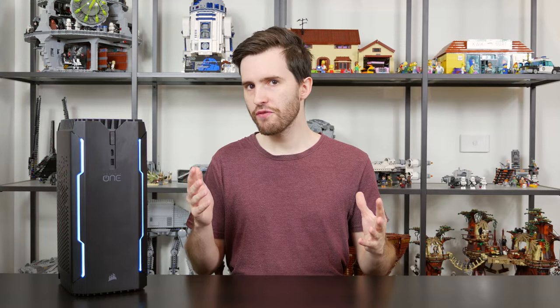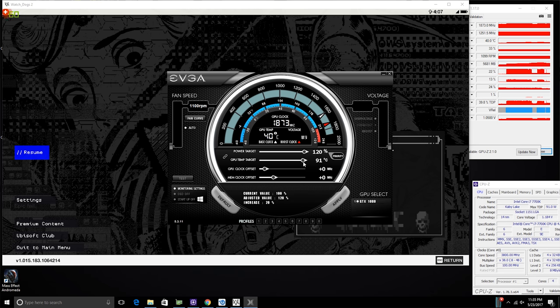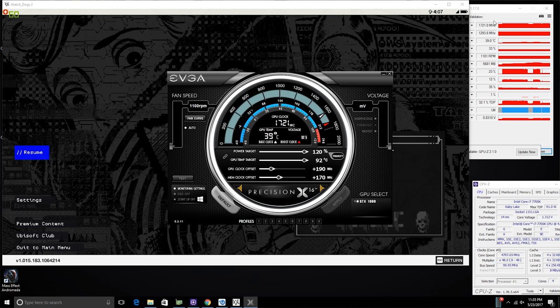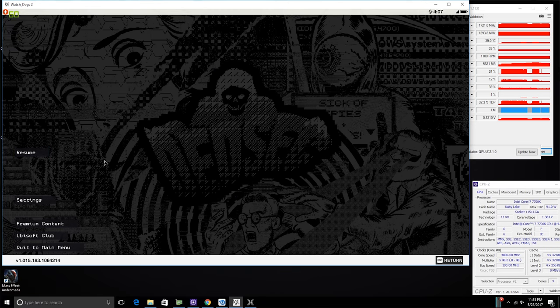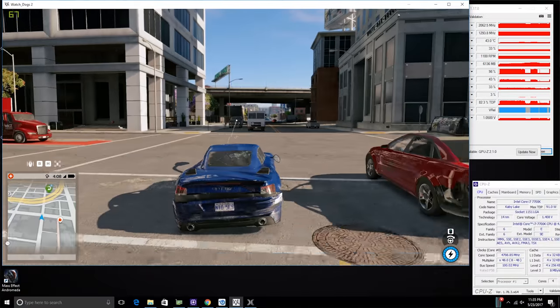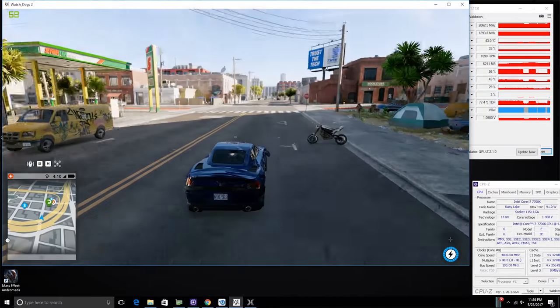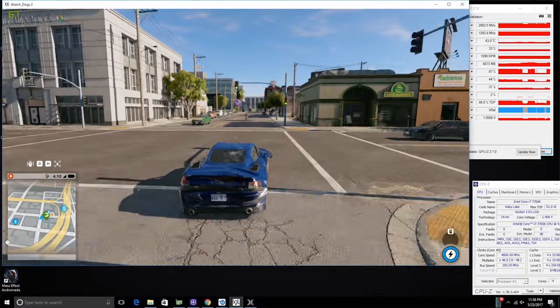As for the GPU, you can do pretty much whatever you like because there's so much thermal headroom. I pushed plus 190MHz on the GTX 1080's core clock and around plus 170 on the memory. The GPU was then running constantly at over 2000MHz no matter what situation we threw at it, and that only added one degree Celsius to the temperature of the GPU. So plenty of overclocking headroom — you can basically push it to the limits of the GTX 1080 and get an extra 10 to 11 percent more performance without making the system any louder or hotter.